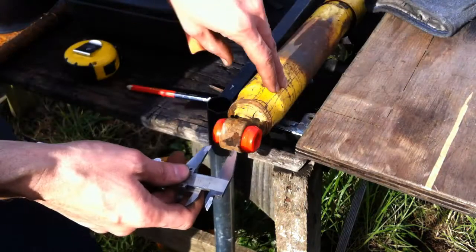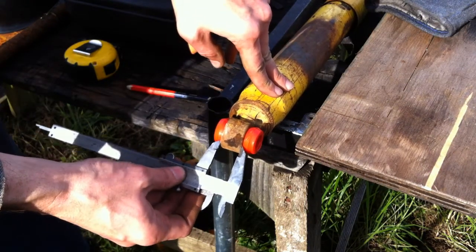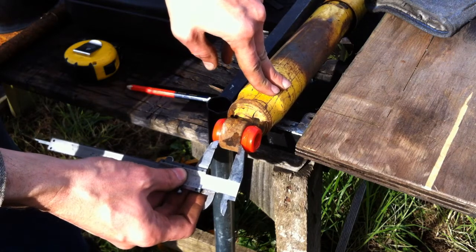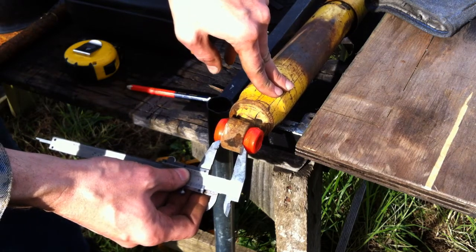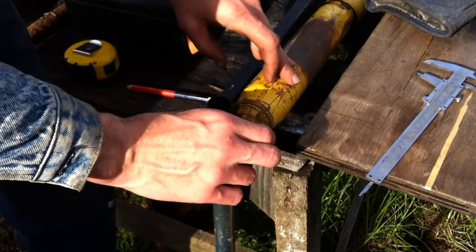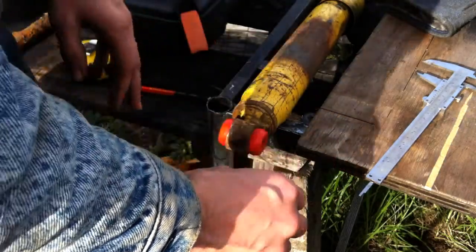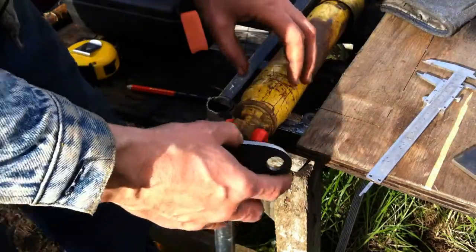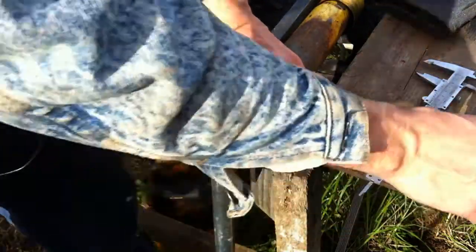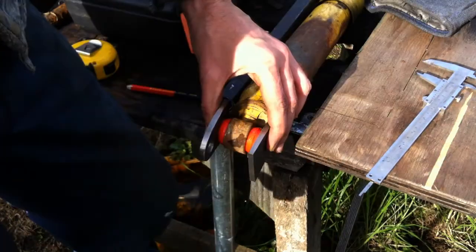Here with the shock, I've already taken the measurement on the shock that's on the truck to know that this mounting point is the same width. It's 15 sixteenths of an inch in width. But what I've also noticed is that these pieces here need to be compressed inside it a little bit, so what I'm going to do is compress it using these tabs and a clamp.